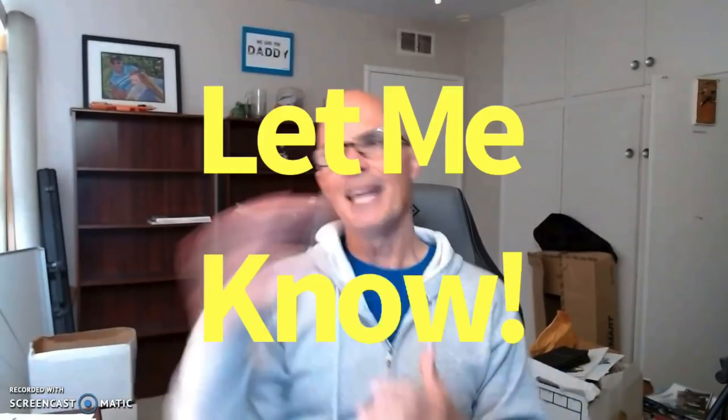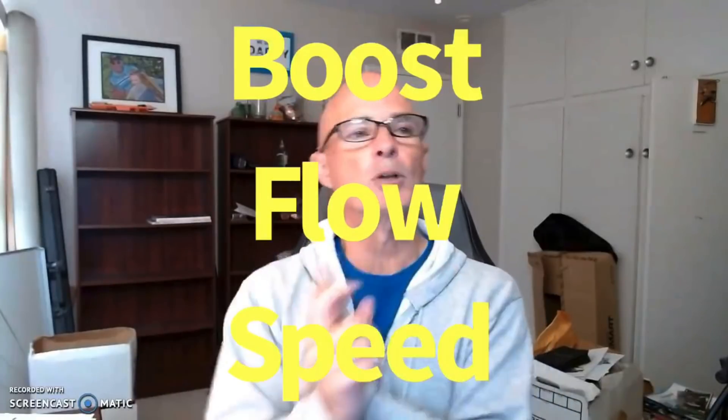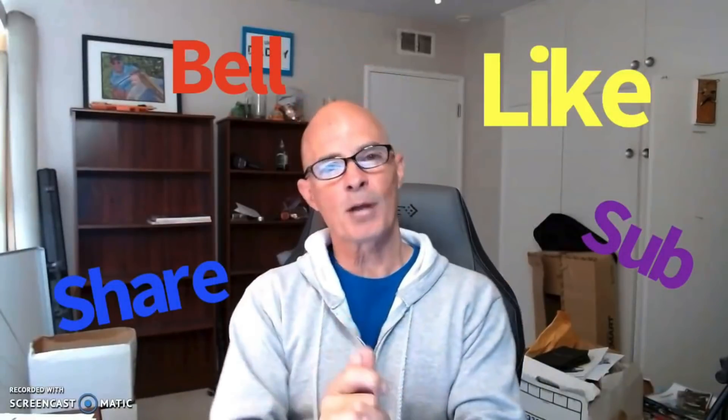Can we use the bypass valve to regulate boost like you do with a wastegate? Let me know in the comments. The next thing is how much power does it actually take to drive the blower? We did some speculation based on the naturally aspirated power output and how much we were making with our bypass closed run at that same blower speed but at a much lower boost level. The ideal thing is take this blower, put it on a blower dyno, and we'll know exactly how much power it takes at any given combination of boost, airflow, and blower speed. Using the math, we figure it takes somewhere between 60 to 80 horsepower to drive this thing at the 700 horsepower power level. I'm Richard Oldner — make sure to like, share, subscribe, ring the bell. As always, I'll keep testing.